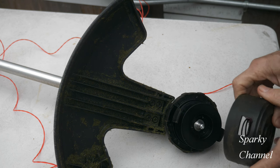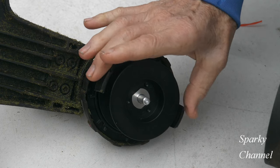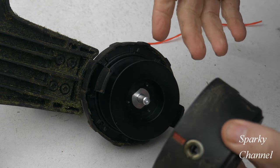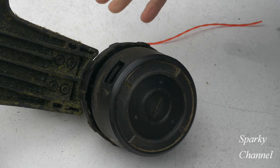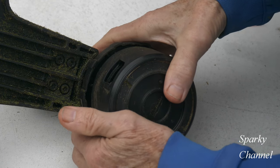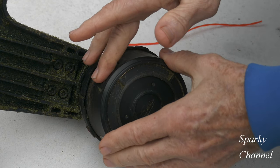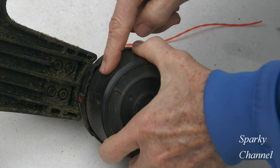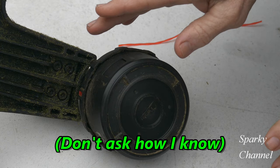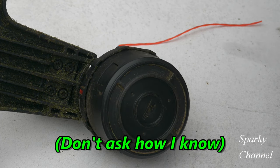If not, just close it back up. You'll see it's got a hole here and tabs here, so you take this and put it on and just push it in — you're gonna listen for a good click. You need a good click. There we go, that sounds good. Make sure the tabs are all the way in, because if they aren't, when you turn on your string trimmer the head might just fly off.